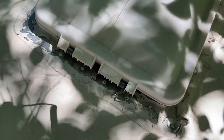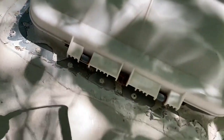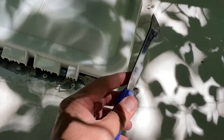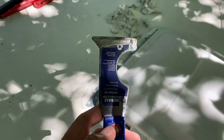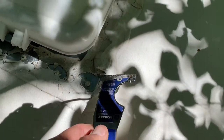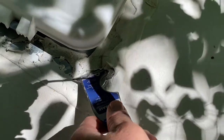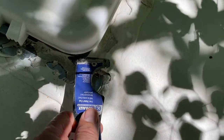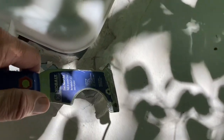As the saying goes, plan the work and work the plan. It's 3:28 now - I started at 3:17 and I'm already halfway done. The MVP - or I should say MVT, most valuable tool - so far for this project is this 5-in-1 painter's tool. Again, this is metal and my roof is rubber, so I've got to be super careful. A tip: always scrape towards your vent - if you slip, you're just going to hit metal.